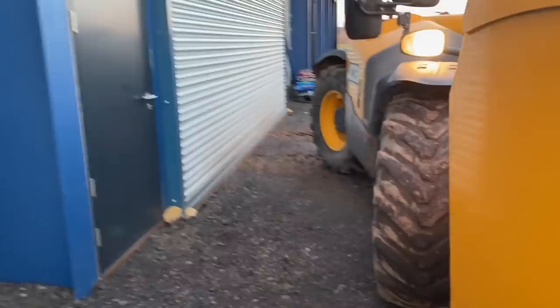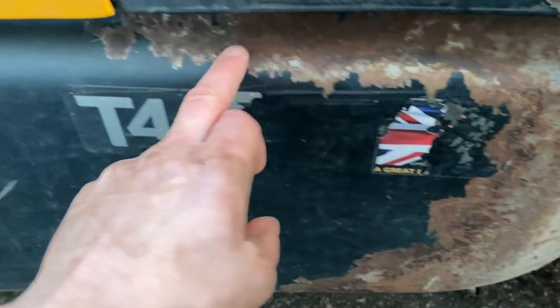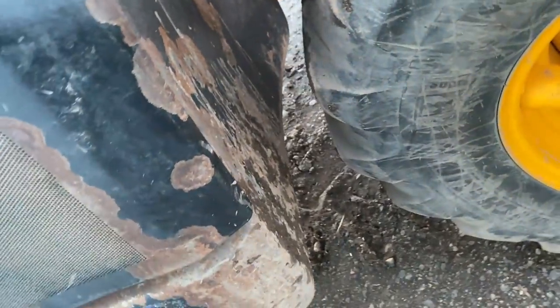You get a lot of machines with plastic parts that are flimsy. A lot of power tools are made with plastics which are glass fibre reinforced - between like 15 and 40% glass fibre reinforced - it makes it nice and solid. You look there - I didn't wash it brilliantly and it's already dirty again but it comes up nice. Whereas around here on the base of the engine bay it's metal and you lose the paint, it starts to chip, rust spots start to show up all around it and it just spreads like wildfire. Once moisture gets under the paint it's over really - I should take it off and respray it.